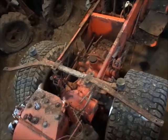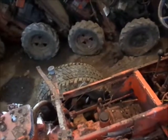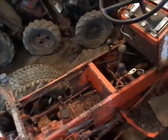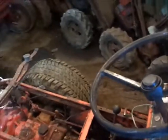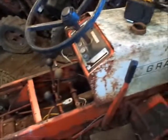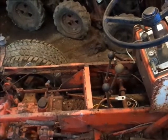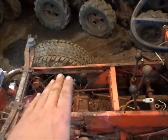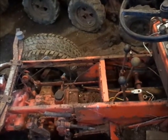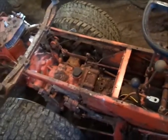With the seat pan out of the way you can see everything here. Now, probably if you had two people, one guy could just slide the transmission back and one guy could hold up on the frame, then you both come over here and put blocks under it. But since Steve is a one-man army here, I think what I'm going to do is block these front wheels so they can't roll back, and then I'll get a jack and put it underneath — or put it under the back of the transmission so that when I unbolt it, it doesn't just fling up. I really need two jacks. Interesting — I don't have any jack stands.